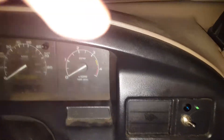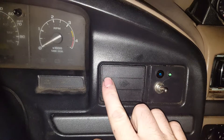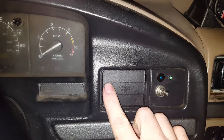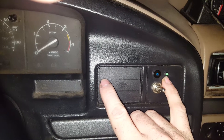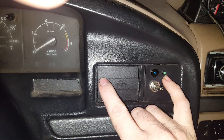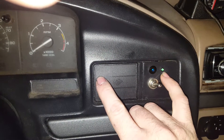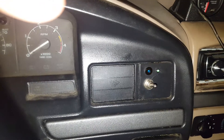I'm just going to do a real quick video on my glow plug indicator light. The one on the dash here only stays on for about two to five seconds. This one right here, which is a 5/32nd LED — you can see the size difference, this one's a quarter inch — it acts more like a dummy light. This one actually shows you the true cycle of a glow plug.